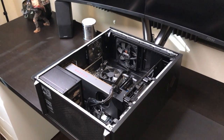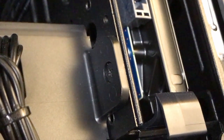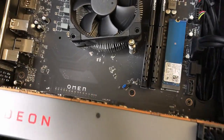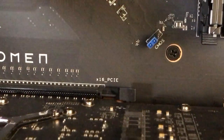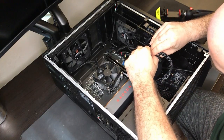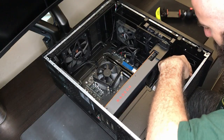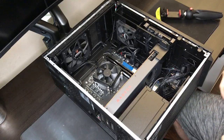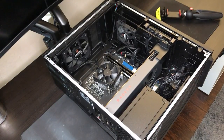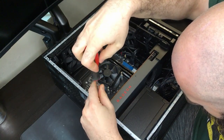First, we're going to start off with the graphics card connector. We're going to remove the two screws at the back of the GPU, and also remove the sag bracket. On the motherboard itself, there is a little push clip that is going to release the graphics card. You basically pull a little tab and then pull up. Make sure that you do not pull any of the connections on the motherboard from the wires themselves — only grab it by the connector head. It's very important because you don't want a pin to come loose.